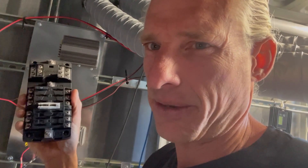Now if there would have been an emergency and this thing had died, I would have just been able to switch everything. But what I found is this dual-input fuse panel — same company as that breaker box over there. This actually has the ability to take two sources of power, perfect for what I've got here. That way I always have a backup wired into the system. I have two converters — one's going to run lights, one's going to run the furnace. And if one ever dies, it's just a simple matter of moving some wires around to go back to full power. Either one of these is enough to run everything by itself.